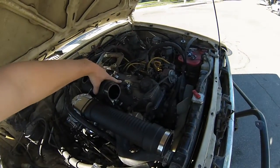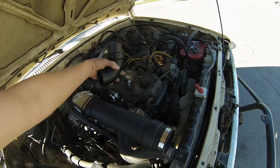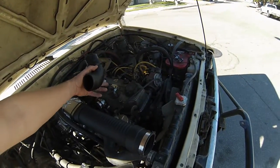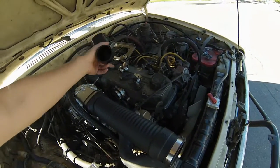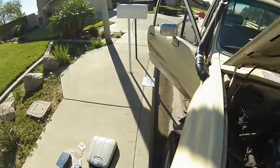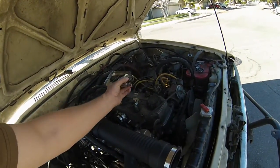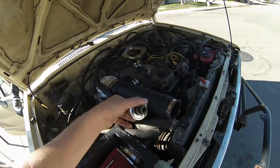I wasn't able to. I basically completely forgot to include the PCV valve, the positive crankcase ventilation valve, or not the PCV valve, but the breather. It's part of the emission system and goes back into the intake so that any gas that's not burned can be burned. But I'm just going to put a filter I had right on top of that. I've seen them done, you know what I mean? I know a bunch of people that have that there, so it'll be no issue. I just completely forgot about that. Otherwise, I would have built a hole somewhere into this system to reroute it back in.